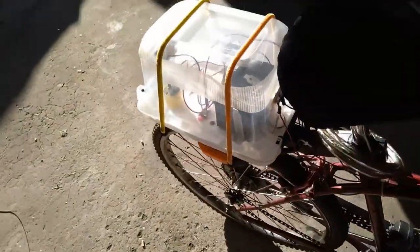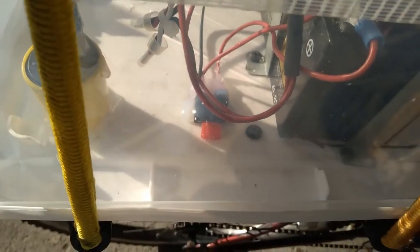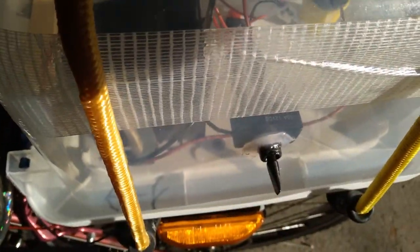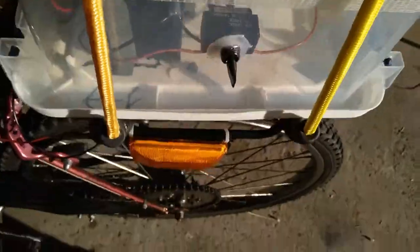All right, let's talk about it. So, 12-volt battery mounted to the case, mounted to the bottom with our little pieces of metal. That comes out to our 10-amp fuse right there. Fuse then goes to our switch, main switch right over here on this side. That is circuit on right here. This turns on the complete circuit. And that center is off. This is also off because it's a three-way switch and I don't have anything wired up this way yet.